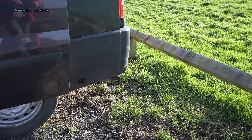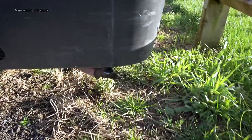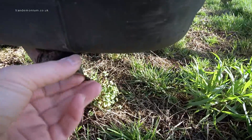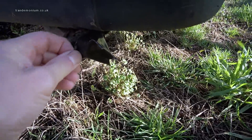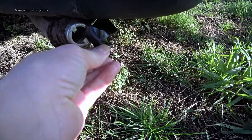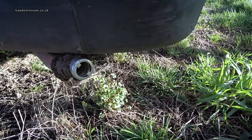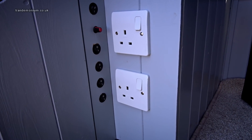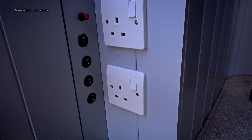First things first — in order to fire up the heater I need to take off my insect deterrent. I've read many a tale of how these heaters are scuppered by insects crawling up the exhaust pipe and the air inlet pipe. Apparently if you get a dead spider in the heater unit you have to take the entire heater apart. So when the van is not being used I just put some gaffer tape over the end to stop spiders crawling up it. Having done that with both the exhaust and the air inlet, I can now switch the power on to the heater.